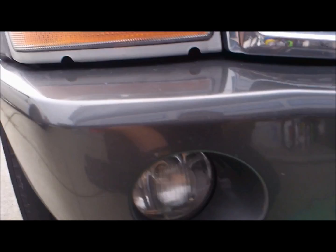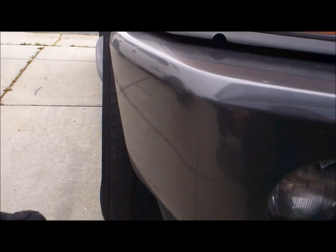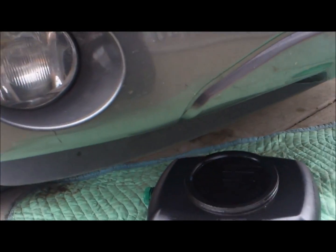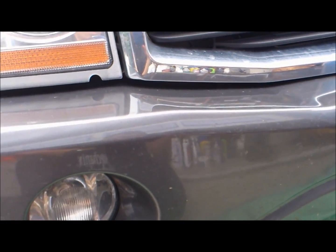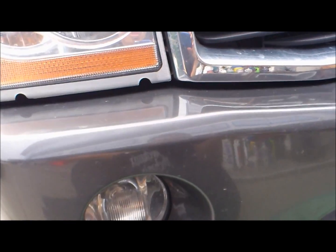And yeah, so first off, we're gonna go ahead and secure the car by putting cinder blocks in the back of the car so it prevents the car from rolling forward. Make sure the e-brake is engaged and the car is in park and the engine is cool enough for you to touch the oil so you don't burn yourself. Alright, so you can jack up the car. You can fit underneath, but I'm perfectly fine. I can barely fit in, but I have long enough reach to the oil pan.